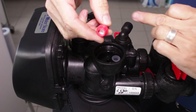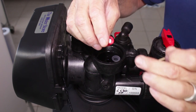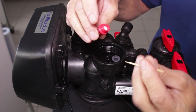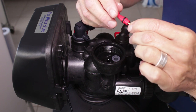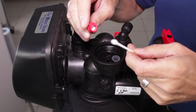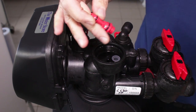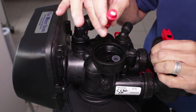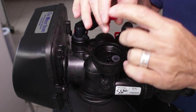There's a hole in the middle — you can hold it up to the light to see if you can see through it. That hole needs to be cleaned. You can't clean it with a piece of wire because you might make the hole slightly bigger and compromise performance. What's best to use is a wooden toothpick — a pointy one — and you just push that inside to open up that hole. Push it in from both sides to remove the debris. Then use a toothpick soaked in CLR or a similar descaler on both ends. Soak the whole injector in CLR; ideally for several hours. Then use the toothpick again from both sides and a Q-tip to clean it once more.